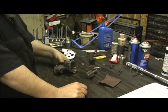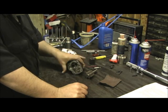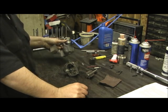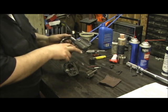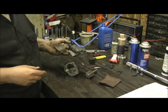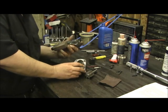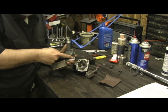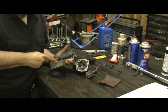This is the 10555 anti-chatter oil pump. The high dollar pump - it came with this bolted to the end of the pickup for that pan, and I went in there and welded this up anyway. Let me explain this to you, and I can't tell you enough: you do not trust that bracket to hold this pickup. If you do, you will lose your motor.